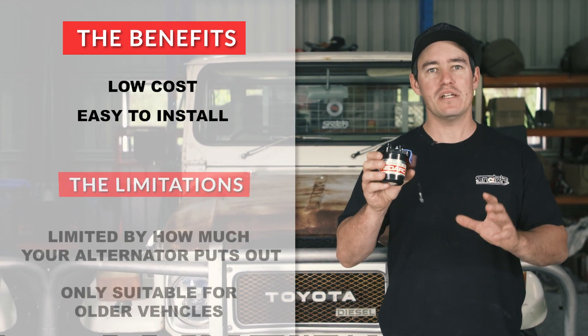You should get the fastest charger your battery can handle. So if you've got a regular AGM battery that can handle 14.6 volts and 30 amps of charge, you should get a charger with 25 to 30 amps of charging power. If you have two of those batteries, you can charge them at double the current. So your battery bank can handle 60 amps of charge, so you can run something like the BC-DC-1250D, which is the exact same setup in the 79. You can use a smaller charger on that battery bank, but it'll take a lot longer to charge. We recommend the highest amp rated charger that your batteries can handle — I reckon that's a pretty simple rule to live by.